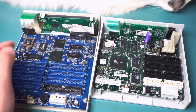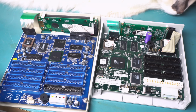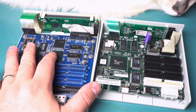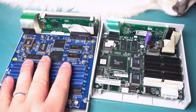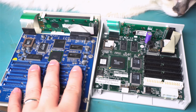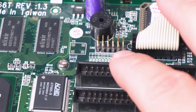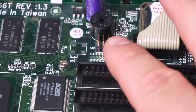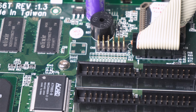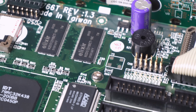This one, I couldn't find any information on the chips, but presumably this is a microcontroller because it's tied into the LCD and it's probably handling all the user interface and just standard stuff like that. And it will have the aforementioned controller that's actually handling all the data transfer because it's got to send it to all these drives simultaneously. Some programming headers. These things commonly have lots of GPIO and other stuff because they're used in customized applications. The smaller unit has a bunch of outputs. I think they're all GPIO or possibly just LED indicators for the various drives. A simple operating system that just handles all the inputs and translates that into commands for the drives.